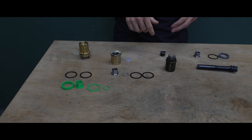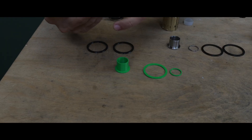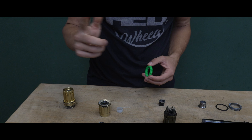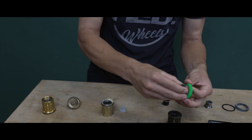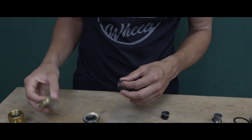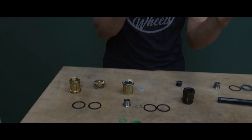The only thing we needed to achieve was to create a transition between the parts of the Scope free hub mechanism and the Princeton wheel. We did that by 3D scanning the existing components and 3D printing prototype designs. This is the driving adapter — I can't take the credit for that, the company we work with came up with it. It uses the outer tooth profile of the Princeton free hub and the inner tooth profile of the Scope free hub. The Scope free hub is operated by a flat spring instead of a more standard coil spring, so we need an adapter to house it all together and take up the extra space.